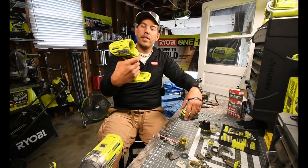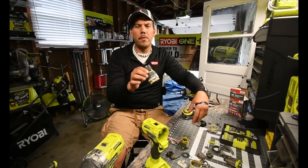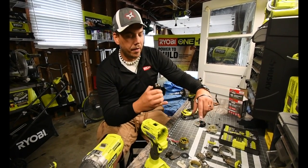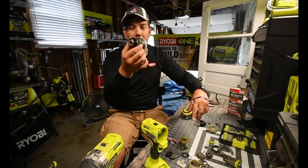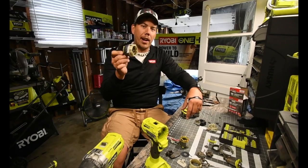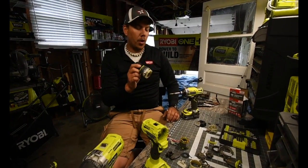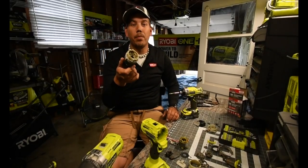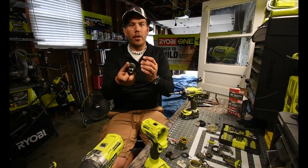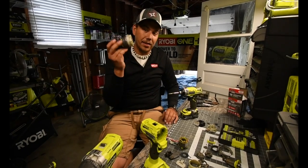So this is cool. I like the body, though. This body design is awesome. Yeah, too bad I couldn't open this up. I think I watched some videos on how to do this. You actually need to take the chuck off first because you need the locking system that is inside the drill to lock this up so you can take this off, because I stripped the shaft in there by trying to pry it off with hand tools. But you need to take the chuck off first when it comes to the tool, because the locking system locks this in place so you can unscrew it. I was able to get the screw out, but you need to unscrew this, as it has reversed threads in the body. So the only way to do that is to have this locked, and the gears will lock this up without stripping it.